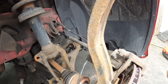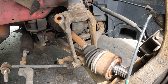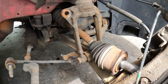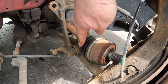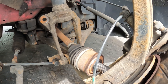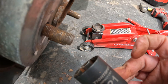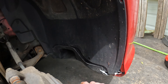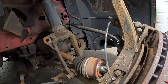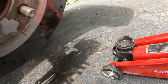We're at the step to remove the top — you guys can see the axle right there. We have two options: option one, remove this clevis and twist it this way. If that doesn't work, option two is to take a size 21, remove the lower ball joint bolt, hit it with a hammer, move the whole thing over, and then take off the clevis. I'm probably going to remove the lower ball joint bolt.